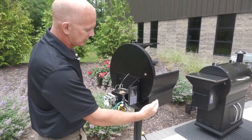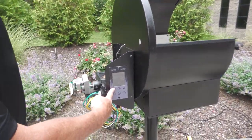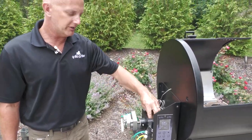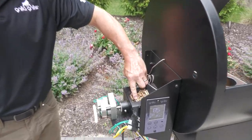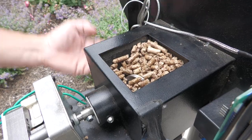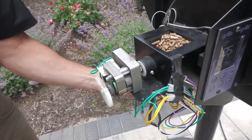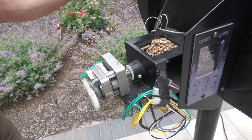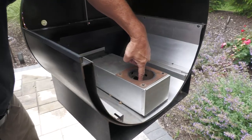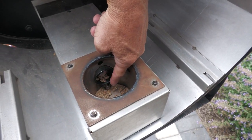So the way these things work, you simply come over here, you turn your grill on by pressing the power button, your grill starts up. You can see we got an auger motor here. If you look inside here, you can see the auger turning. This is delivering the pellets into the burn pot. Underneath, you can hear a fan running — that fan delivers air to the burn pot. And if you come around the side, down inside the burn pot, if you look down in the bottom, you'll see a little rod sticking out. It kind of looks like a AA battery. That's your hot rod.